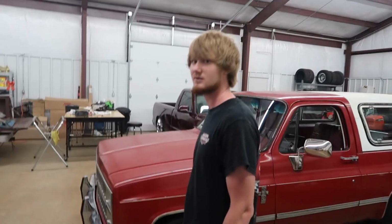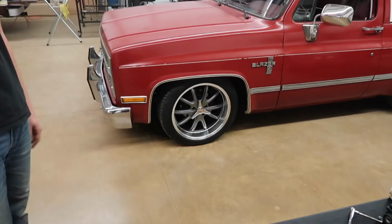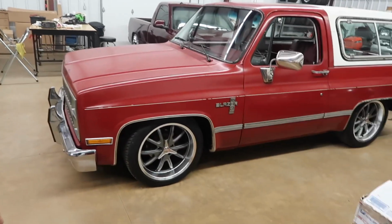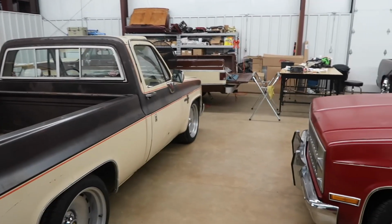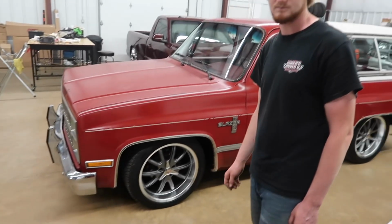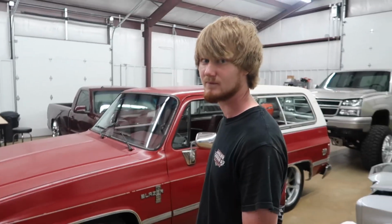And so when we put this 2-inch spring on this truck, we were like, that's way too high, and it only looks like it's about an inch shorter. So we've determined we think we got a 3-inch spindle on this K5, with now a 3-inch spring. So this thing's about a 6 up front. And we ended up putting a 3-inch spring on this, and it's got a 2.5 spindle. So that's about a 5, but the K5 still has it beat, so it's still lower. And the K5 is drivable, for the most part.